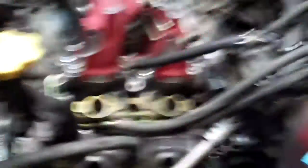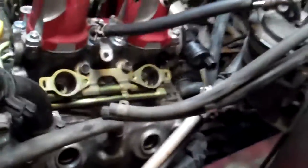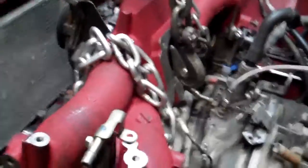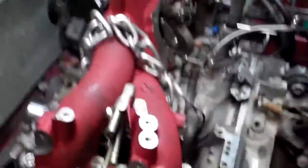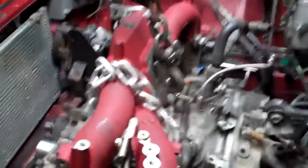So some new stuff to cover. For injectors, I'm going with a set of STI yellowtops — that's more than sufficient, and I can uncap those and they'd be 850cc, which would be far too sufficient. So I'll rock them as stock for a little while and maybe uncap them later. For the throttle body, I managed to get hooked up on what I think is an 03 WRX throttle body — the one that had the idle air control all in one. It wasn't drive-by-wire, but it had an actual idle air control valve on the throttle body itself, which is nice. Otherwise my only other option would have been adjusting the throttle stop.